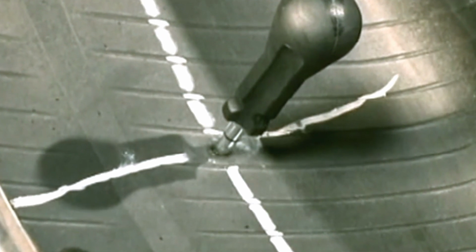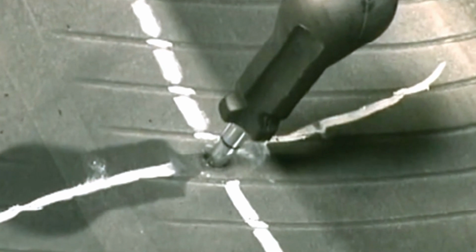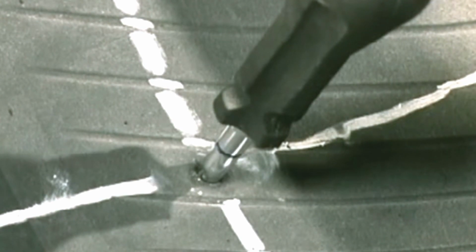Here we can see our injury has accepted the measuring tool with only the black line of the tool visible inside the tire. Thus, we will use a 251UL Uniseal Ultra, which repairs 1/4 inch or 6 millimeter injuries.